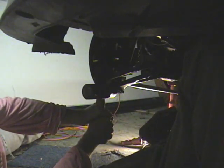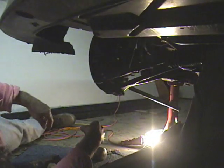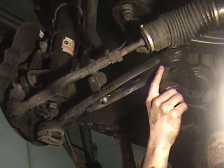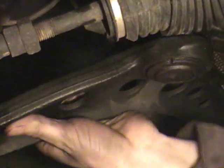You'll need a friend for this. Now that the nut is removed from the middle ball joint, the only thing holding it up right now is the bolt on the lower ball joint and the bracket back here. There is some angle friction going on up here between the bolt going up into the car, so just in case, make sure you have a sturdy hold on here when you take this bolt off. Because if this thing falls on you, it's going to hurt.